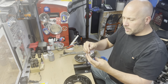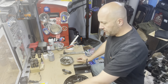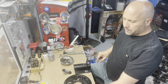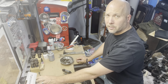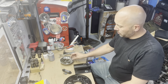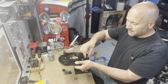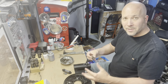The drum gets hot. We have all of our component parts: a new wheel cylinder with a bleeder screw that'll bolt right in, the bolt to hold that in, a bearing kit with your inner and outer bearings and your seal, a spring kit — that's all you need for your fronts — new brake shoes, and I did clean up a few of the components. The star wheel adjusters were corroded and stuck in the holes, so I worked them out of there.